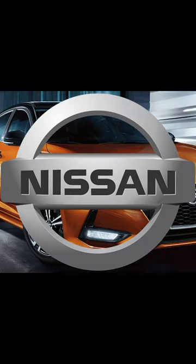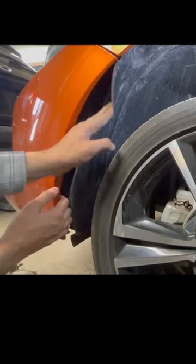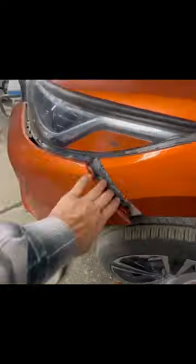To take out the grille for a 2020 Nissan Sentra, remove the front bumper first. Lift the car a little bit. These are the 10mm screws — use an impact gun to take out the 10mm screws from underneath. This enables us to push the fender liner and take out that one 10mm screw.